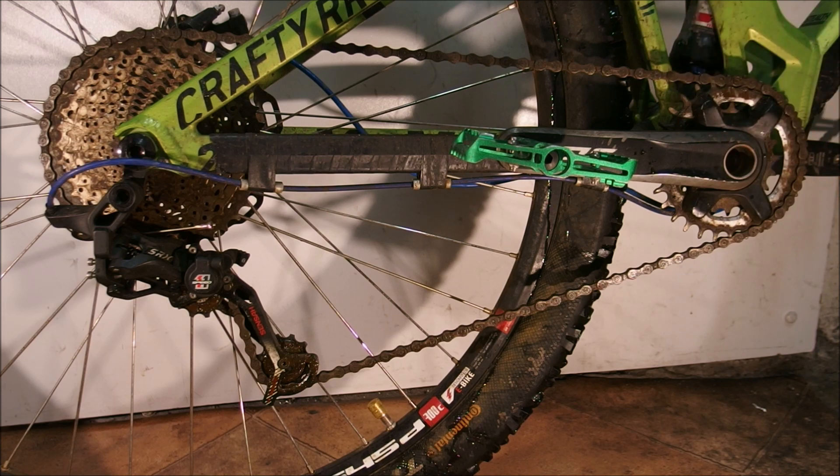This is one of the reasons why you're having problems with backpedaling on the 1x drivetrain. The important part about this entire equation is the triangulation of the angle and the deflection between the chainring and the cog on the cassette, and that's mostly influenced by the length between the cogs.